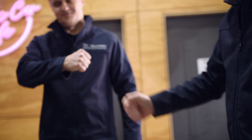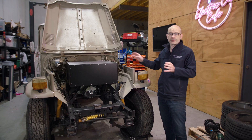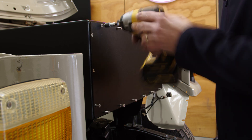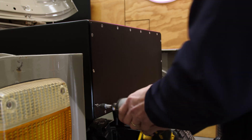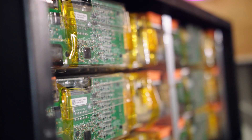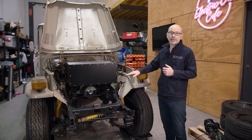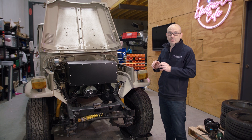You can see straight away we've got the front battery box fitted and actually populated now, which is obviously great news — that means we've essentially got pack voltage to play with. You'll see it's pretty high in the motor bay, but that's deliberate: this vehicle will be used for off-road stuff, river crossings and all that kind of thing, so it has to be high and out of the way. We've also got a motor with high-voltage connections underneath there, so we need a bit of clearance anyway. The good news is it's in, secure, and the rest of the build can now come together.